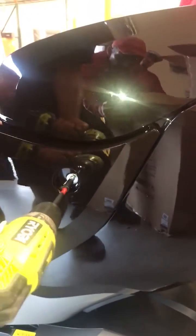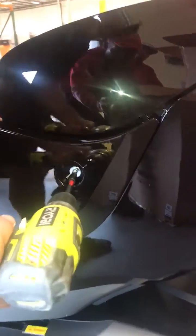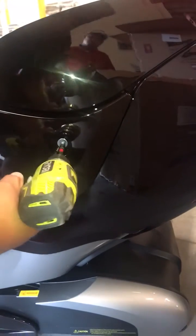If you pull open a little bit, you'll be able to see the socket where you need to get the screw and you can line it up easier. Oh, what's going on there? There we go. And I just barely get it started. So like I said, everything, keep it loose until the end, because this one down here is a pain in the butt. You'll drop this screw 1,000 times, so try not to. Use magnetic tips as much as possible. Look at it first with a light, look at where the hole is, and generally speaking, what you have to do is pull the arm forward like this and up a little bit, and that will line it up. That's usually how it goes.